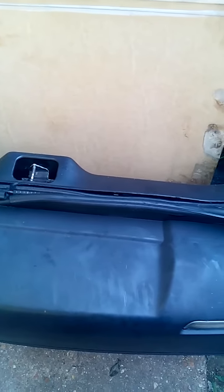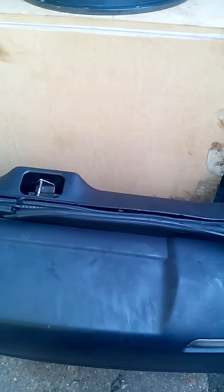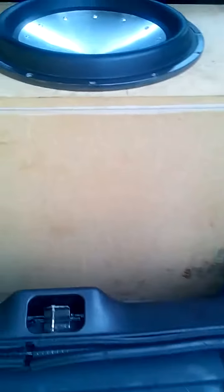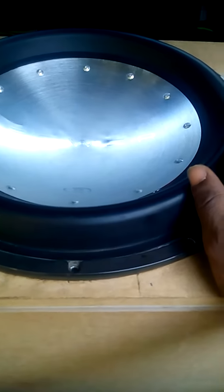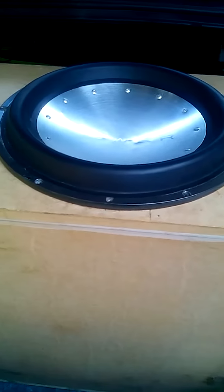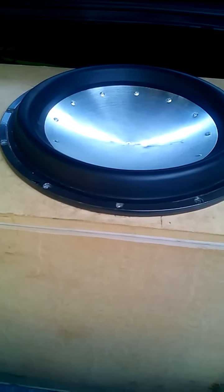I just had it on the AudioPipe 3000. It's a D4, so I bridged it, put the 3000 watts on that hole to see what she'll do. She cried, bottomed out, can't take no power. I know it's rated 1000 watts RMS, but you got a Sundown SA-15 rated at 600 RMS, and I done put 2400 watts on it and it took it with no problem.